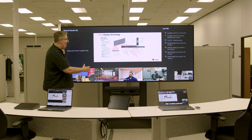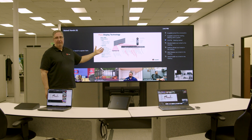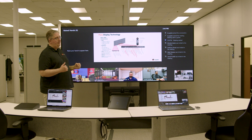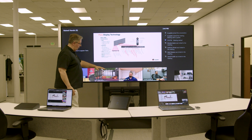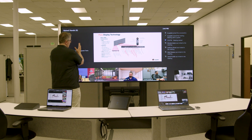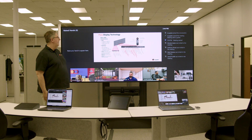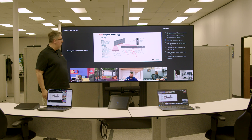You can adjust how big these areas are only by changing the resolution. Right now we're running 3440 by 1440 as the resolution to the panel from the MTR PC. If you go to the Microsoft-recommended 2560 by 1080, the content is going to be smaller and these areas are going to be even taller. If you go the other way to 3840 by 1620, everything gets pushed to the side — the side areas get narrower, the center gets bigger, and the participants get shorter. The MTR app doesn't have a way to resize the layout elements directly, so you have to do it through resolution.